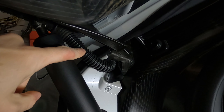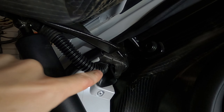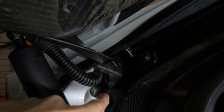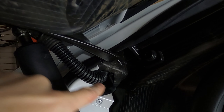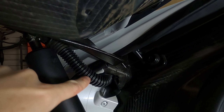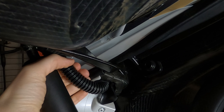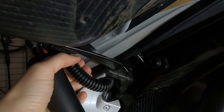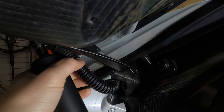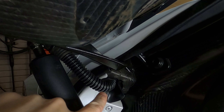When the door is open on the BMW i8, you can see this protective covering over the wiring harness. As the door moves in and out, it actually rubs against these other plastic pieces and that causes stress on this part. Not only is it constantly moving back and forth as you open the door, but it's also pulling. If I give this a little bit of a pull, there is a little bit of stretch here, but it's really tight. And because it's tight, it's actually trying to pull itself apart and over time it actually does.